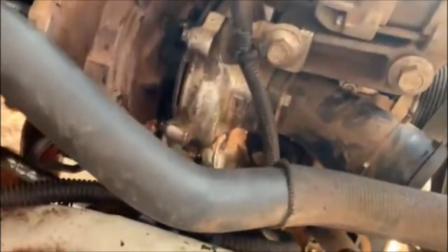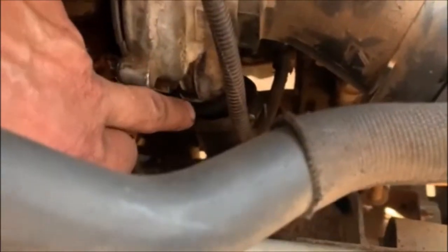So all that's left now is the actuator wire, which I also really can't get to from here, and the 3 bolts on the manifold. I'm going to undo those 3 bolts, and then hopefully when the turbocharger moves a little bit, I can get to the actuator wire, because that's that one over there, and I cannot get my hand in there to get it unplugged. So hopefully once I've undone that, I can move it away and undo the plug, and also pull the boost pipe out. I also can't get the boost pipe out, there's not enough space. Anyway, I'm going to undo that quickly.